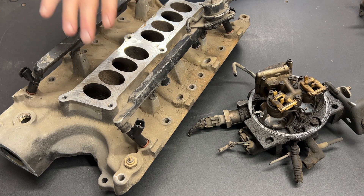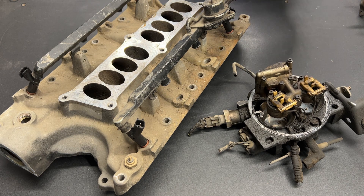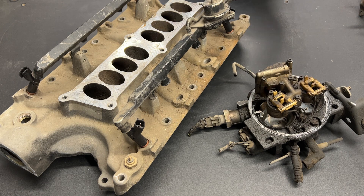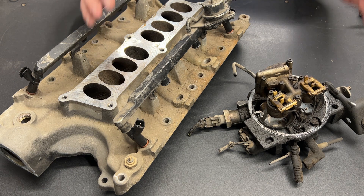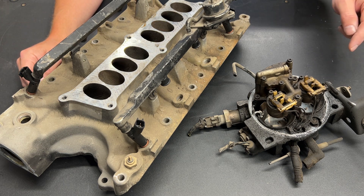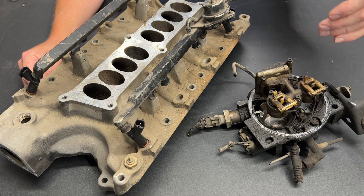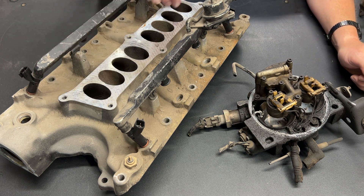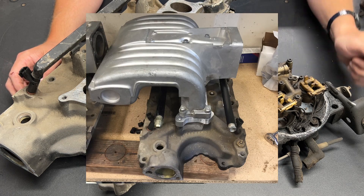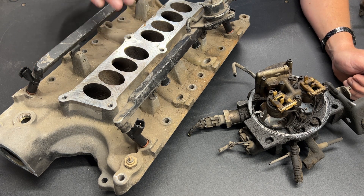This is a truck 351 lower, and this is a Chevy six-cylinder throttle body injector. These two parts have nothing in common, and this is a significant downgrade from the Sniper EFI. So why would I show you these? I am going to build a Frankenstein EFI — electronic Frankenstein injection. What I'm going to do is use two throttle body injectors as throttle bodies, connect the shafts so we have four butterflies feeding into eight openings. The result should be a much higher flowing system than my previous Frankenstein injection with the 5.0 upper and 351 lower, and it should not suffer from strangling at higher RPM.